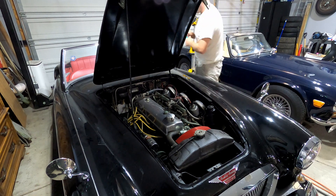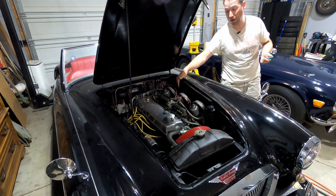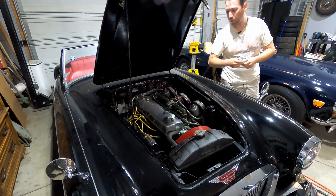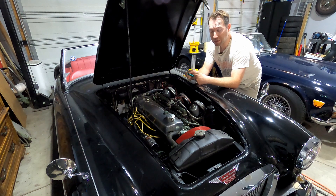Also take a quick look inside the car, because if the master cylinder itself is leaking, it could be draining into the car, which would be kind of unfortunate, but it can happen. Sometimes the seal will fail and it's going to leak down the pedal onto the floor. So if the floor looks clean, the master cylinder looks okay, and your fluid is low, it's probably the slave cylinder that's at fault. As a side note, if the fluid is full and you're still not getting any movement on the clutch, it could be that your master cylinder is junk, the slave cylinder is junk, or something inside the bell housing is junk. But the very first thing you should try is to bleed it.